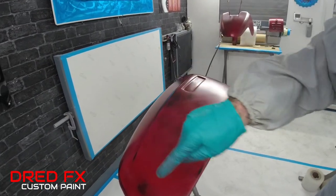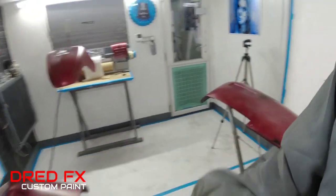In that first time lapse you can see — very light. I'm just building this up nice and light, letting the warm air come over and just dry this down because it's really cold. We're just taking this a step at a time, nice and slow. Don't go too wet on your panels. I'm running medium thinner — I haven't got a fast thinner. It'll just dry out the panel quicker. So I'm just having to take the time, warm it up, let it flash off and then just build the coats up.